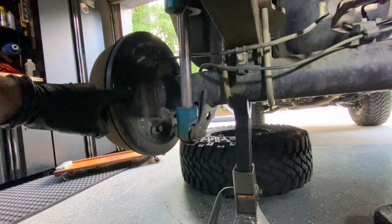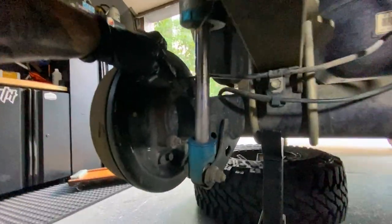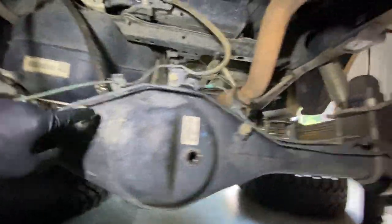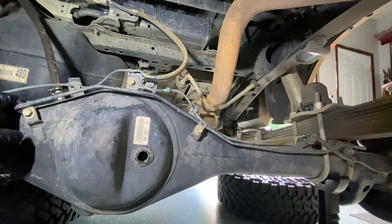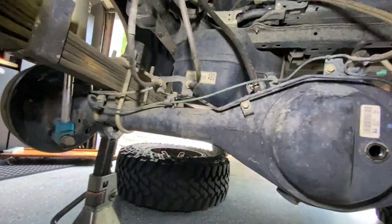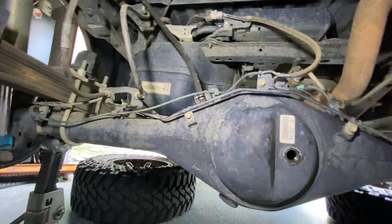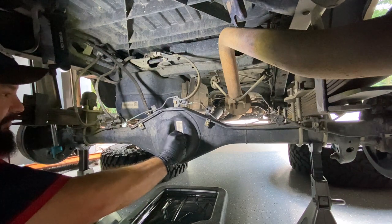While that's draining, let me show you something. When it comes to popping the axles off, you have one option to remove the hub. What I want to try instead of removing the brake line and creating a mess is to remove these four bolts here. Sometimes you get enough flex to slide everything out without removing the brake lines, so no need to bleed the brakes. It's worked on separate vehicles I've had — never done it on the Toyota — but we'll see. There's a hard line but also a soft line here, so you might get enough flex to pop the axles out.